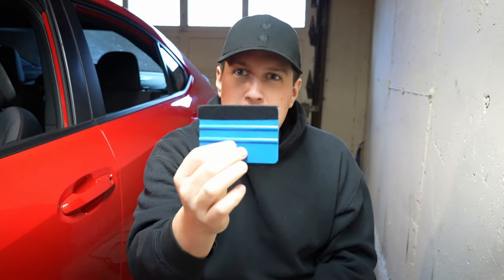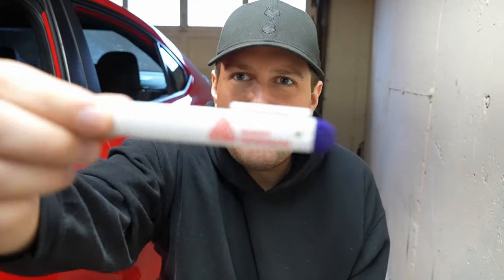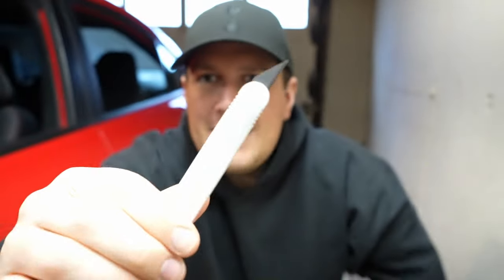Then your install stuff. You're going to get a squeegee at Home Depot - this was $4, just a window squeegee you find in the cleaning supplies section. Then these are your two most important tools: a normal felt-tipped squeegee - the same thing you'd use to apply vinyl wrap - and a window gasket tucker tool. Super inexpensive. And there's one more tool in my pocket: a knife. The knife is very important - you must get a stainless steel knife. Do not buy a cheaper one. I bought mine specifically through Avery Dennison. It has removable breakable blades that you can snap off for a clean edge. If you don't buy a stainless steel knife, you will scratch your windows.